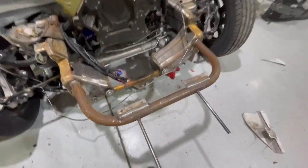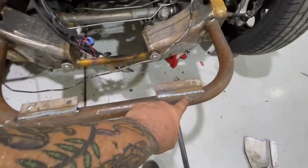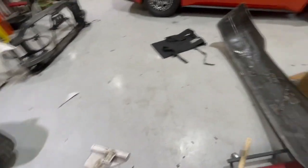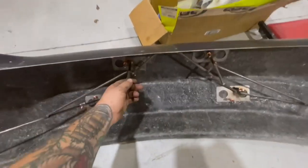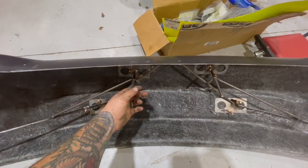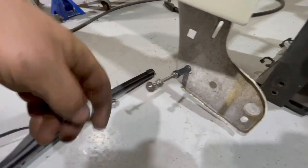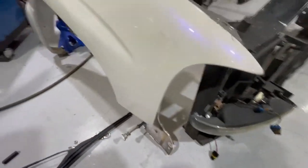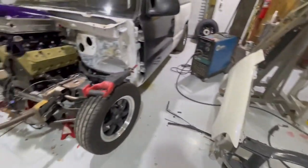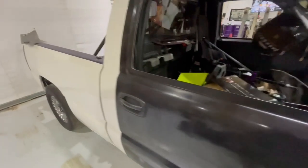Like I said, the bumper mounts here are just hollow tubes, and the core support bolts here. And for those hollow tubes, on the inside of the bumper, we built a tree. There are rods that stick off of it, and they slide into those tubes. On the side, the bumper will come up, and there are a couple of little standoffs here that the quick connects will hold the sides of the bumper on. So everything is coming together as far as that goes. We're going to try to make a little progress on getting the cage and everything painted.